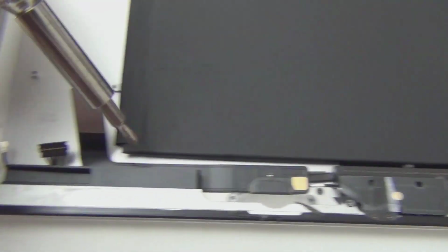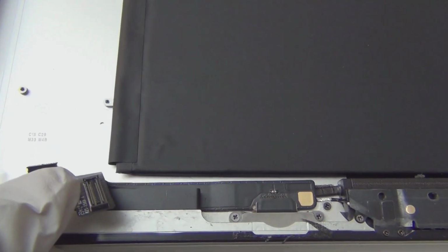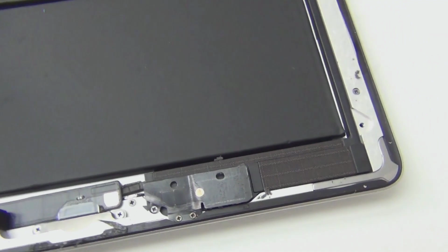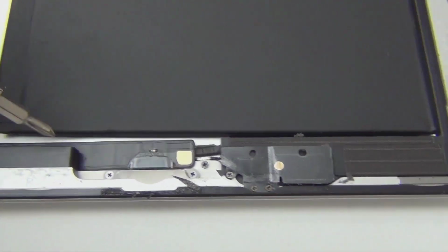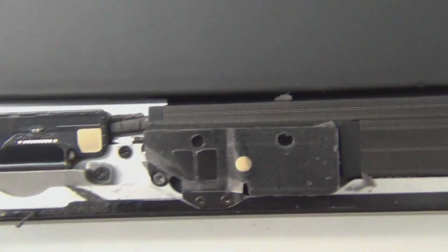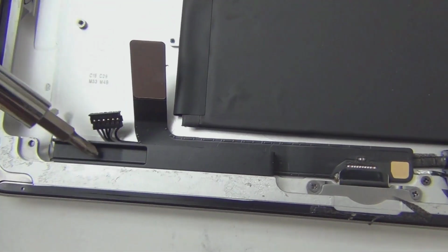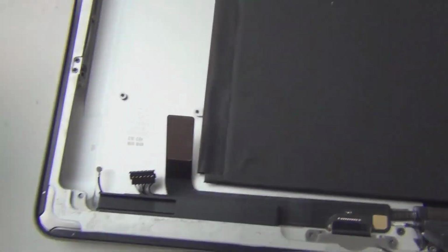And if you want to take the dock connector, the charger cable out, like here, you just take this out, and there's two screws on the dock connector. 1, 2. This whole thing is taped down. A little bit plastic piece. This plastic piece is also taped down. You see this chunk of mass? It's just there to hold everything down, so you can peel this off easy.